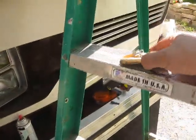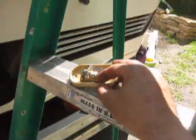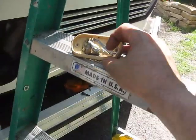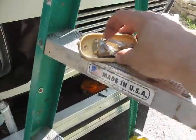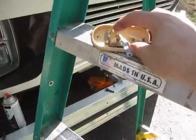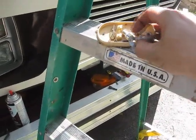But I did want to show you this, because remember I mentioned one of the failures of these guys is that the post breaks. Well, if you notice here, this bulb will not sit in the fixture. There's a reason for that. Look at it, this whole thing wobbles around. Why? The whole thing just broke off at this point. These little 2 plastic tabs just went bad and broke off. So that's another junk fixture. We'll put that in the garbage.